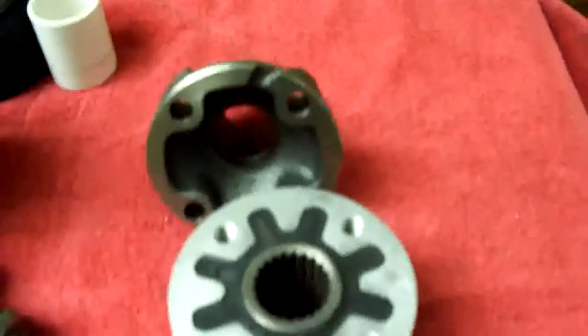That's it. I thought I'd show that to you, and I'm going to take this over to the transmission to give you an idea how this thing goes on here, so you know what I'm talking about. This thing slides on the axle shaft like that. So when this axle's going up and down, it's changing the angle of attack every time I move it. So that's what makes it unique, because it takes all the pressure off the transmission.